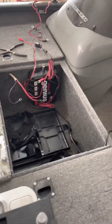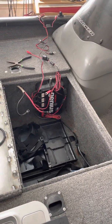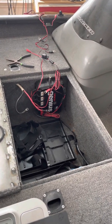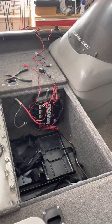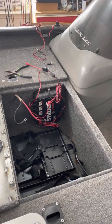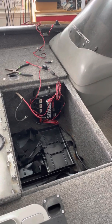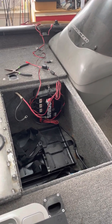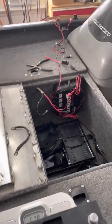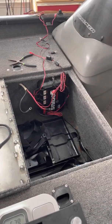I've got the Noco Genius Gen 3 battery charger. As long as your battery charger doesn't put out more than 14.7 volts — this one puts out 14.4 — and it will either have a manual setting or, in this case, an automatic setting for gel cell or AGM batteries, you do not have to get a new charger. You can always double check with Ionic, and they'll let you know. I went on the website, read the specs, talked to the guys at the fishing show, and they said this one works fine.